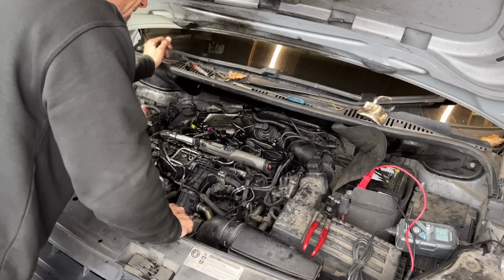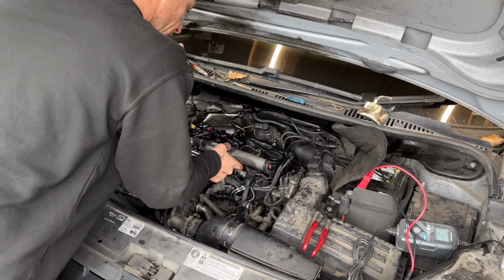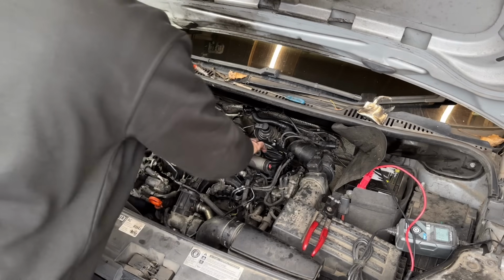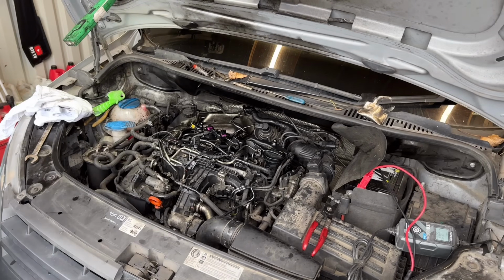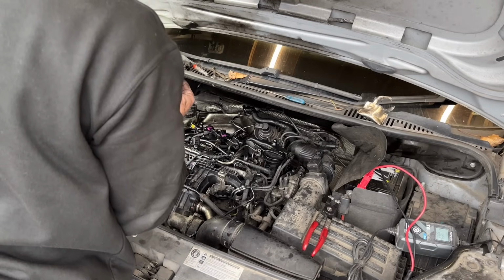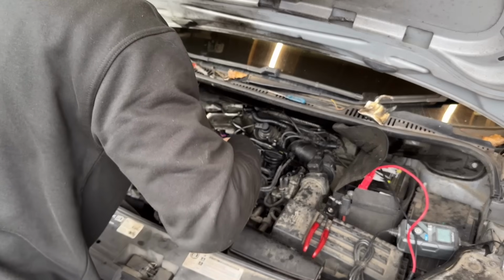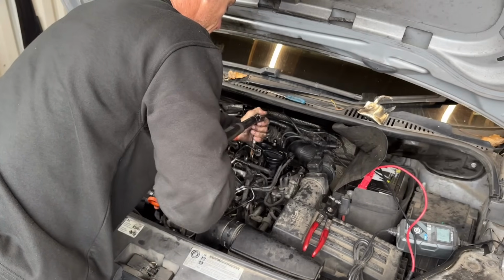Let me get a torque wrench. This is a posh torque wrench. It is a Snap-on digital. Normal torque wrenches, I don't know if they go low enough. I believe they do. Again, I've done many of these injectors with just mechanics feel. But for the sake of the video, we're going proper. 7 newton meters and 180 degrees, I've just read.